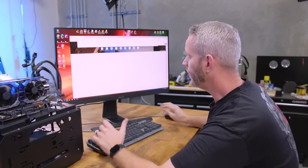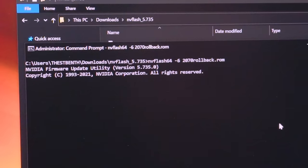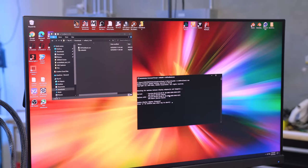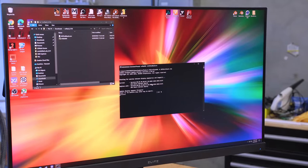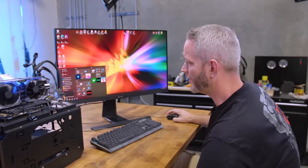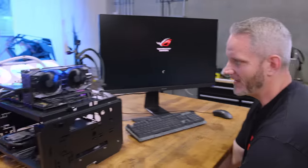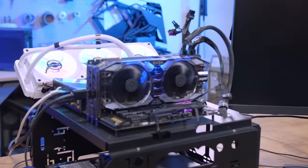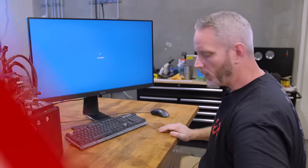After rolling back the driver and reflashing — nothing changed. So let's shut it down and open it up. The wiring on this card has a single plug at the end responsible for both the lighting and the fans. I don't want to take the full cooler off, so I'm just going to remove the perimeter screws and take off just the fan shroud, which will give me better access to the cable harness without risking damage.